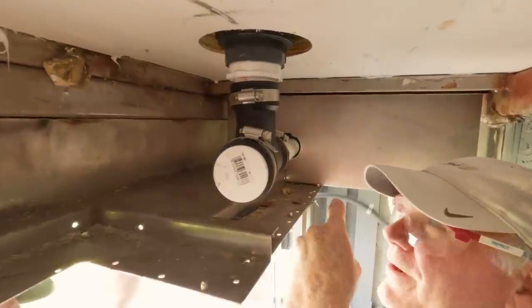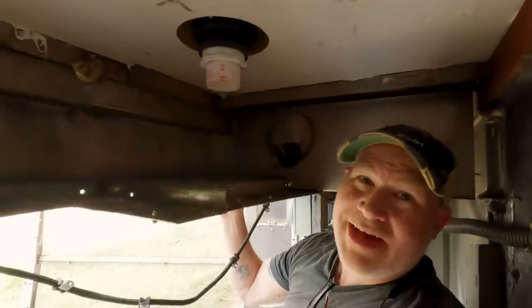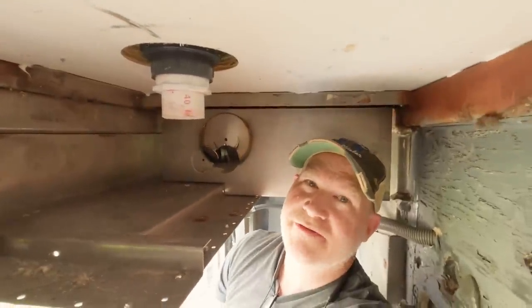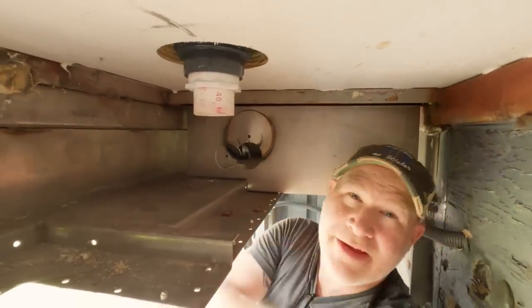The pipe is going that way — you're not going to drain. Just like all of the projects on the bus, things can go pretty smooth until they don't. We realized that in order to get the drain to work up through here, we needed a much bigger hole than we had to get the angle right. We're trying to cut a five-inch hole — we had a two-and-a-half-inch hole. The five-inch hole will let me get the pipe angled downhill so that it drains properly.